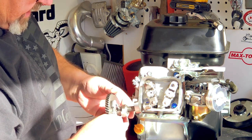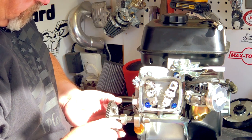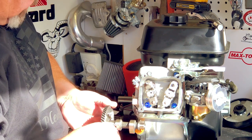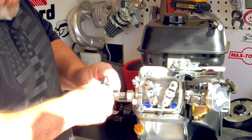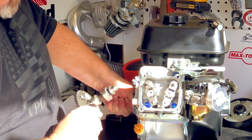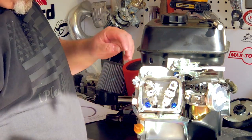Because of the decompressor on the cam, this cam is right about here right now. What I'm going to do is rotate the engine a little bit clockwise — the cam rotates this way and the crank rotates forward. I'm going to go just a few degrees to make sure that the tappet is off the decompressor on the cam.